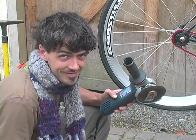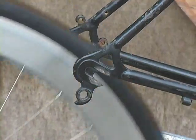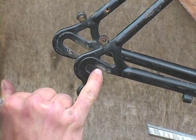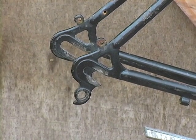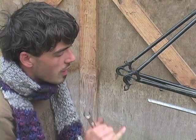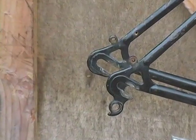Since we don't have any half links, the second option is an angle grinder — totally do not ever do this normally, but it's time to do some angle grinding. Here's the problem: you see this rear dropout? They didn't cut out the rest of the material in there. I've seen this very few times in my life, but it does happen.